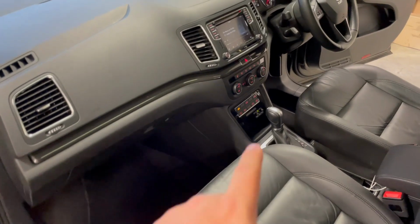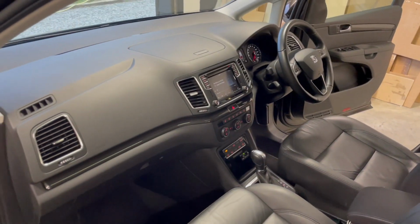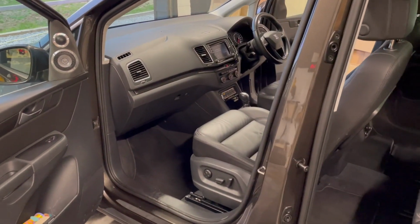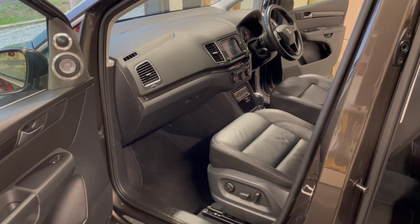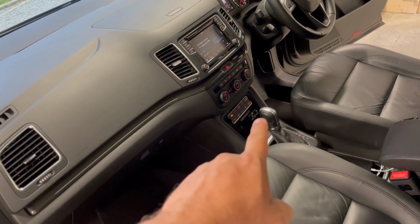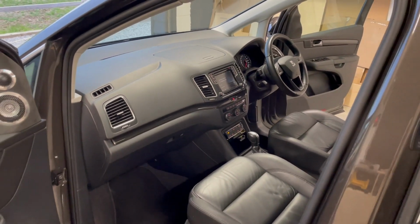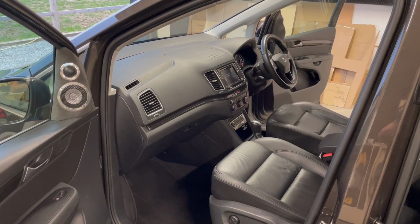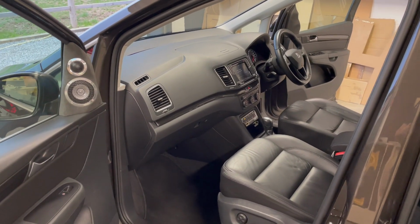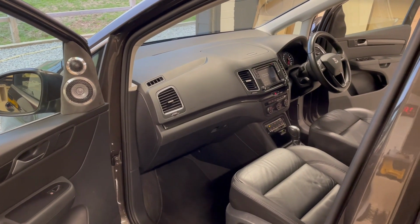We created 2 presets with the Helix UR C3 because we run the Helix V8 DSP for the system, for all the components. 3-way up front, so that's 6 channels, and then 2 channels for the rear fill, which is passive. And we have a pair of outputs for a Zapco ST-500XM monoblock running the sub. So with that tiny little controller, we can control sub level, rear attenuation, so the owner can change the rear fill level, as well as change between 2 presets. So there's a preset for the driver, which is focused on the driver, giving the best possible tune. So left and right is time aligned, and there's proper staging and imaging in the car. But the second preset is like an all-seat preset where everyone gets an equal level of... Yeah, it's a bit tricky.